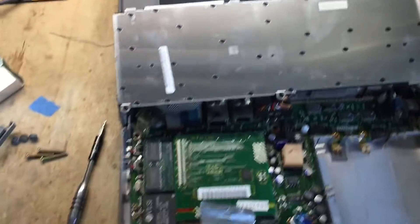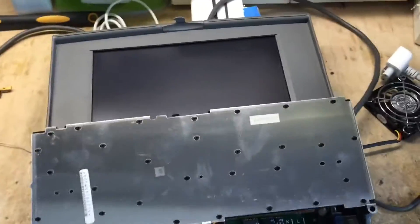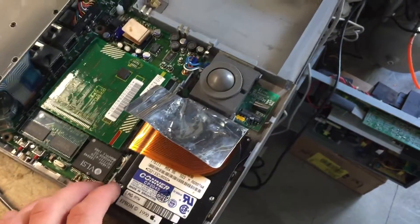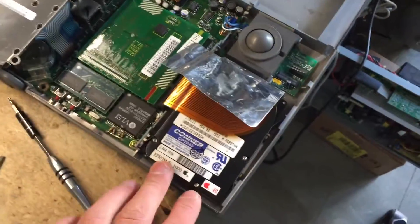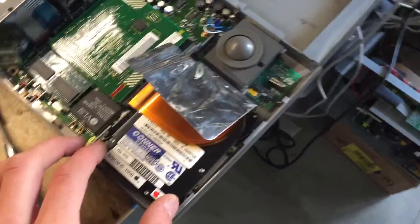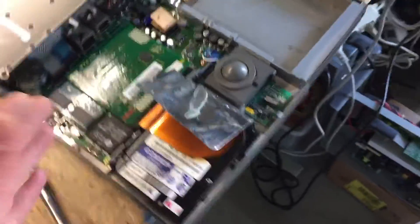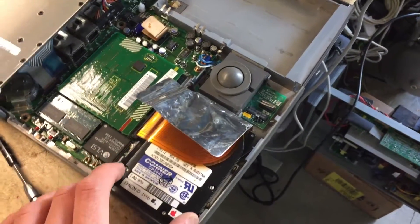Today I'm going to show you how to repair the hard drive inside a Macintosh PowerBook 100. This is a very common fault — it's the same as the 3.5 inch SCSI drives where the disc head sticks to rubber bumpers. When you turn on the machine the drive keeps sticking but it cannot unlock the head, so it will then shut off automatically.